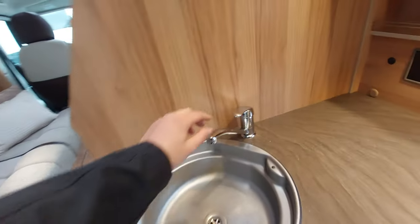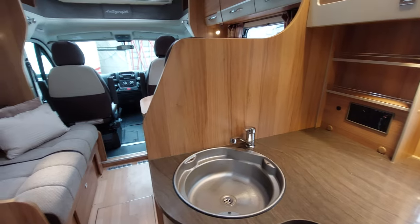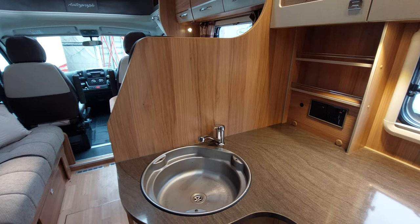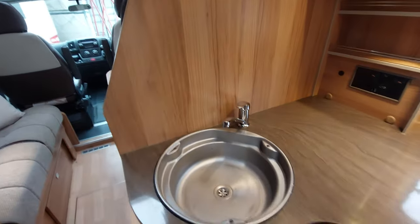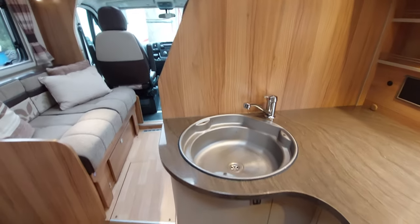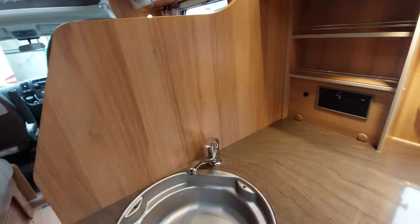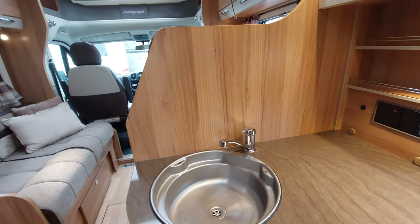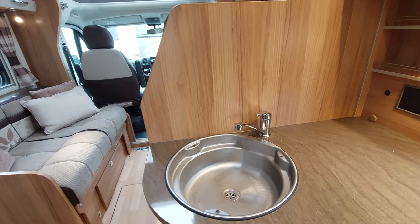When you're on site and filled up with water, click that pump button on, go to all your taps including your shower, and turn them on to hot. That will pull fresh water from the fresh water tank into the boiler - make sure the boiler is sealed when doing this or it will trickle out the bottom. Once it's running steadily, you've primed your system for hot water. Then flick it over to cold and do the same - when it's running steadily you've primed that too. You can then leave your pump on as each tap has a micro switch which will activate and deactivate the pump whenever you need it. The only time you need to turn the pump off is when you run out of water.